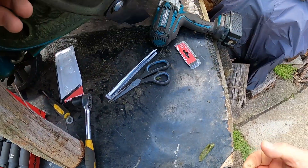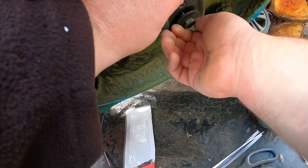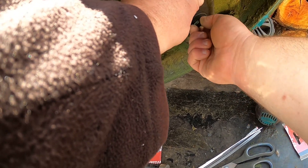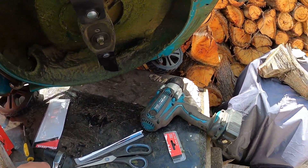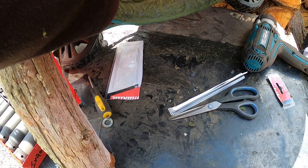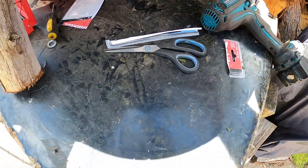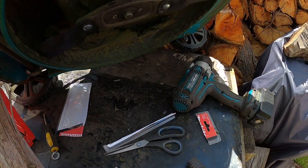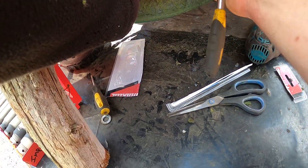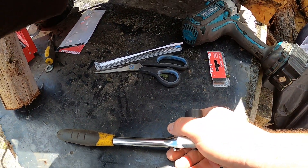I'm not a big fan of mower genuine blades, just that these are the blades they had for this mower. Put the bolt back in here and do it up with my ratchet. I don't mind undoing these bolts with the impact driver, but I don't really want to do them up with the impactor though. Because I've had an experience before on a ride-on where I actually broke the bolt off. So I'll just do it by hand like that.